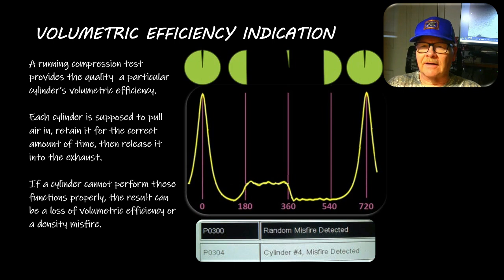This right here is basically a waveform: at top dead center, compression fires, piston goes down and comes back up - it's gone 180 degrees. This is the exhaust stroke pushing the exhaust gas out at basically atmospheric pressure. Then that valve closes.